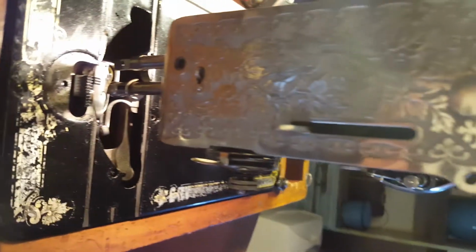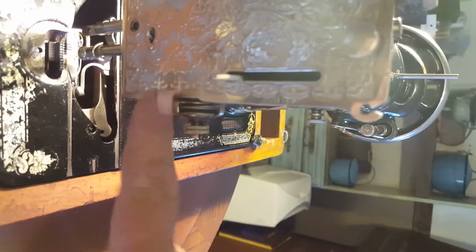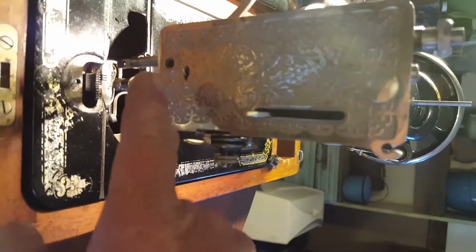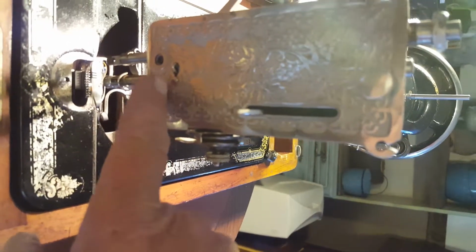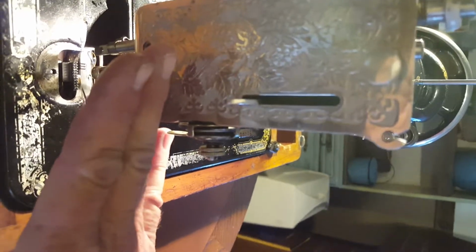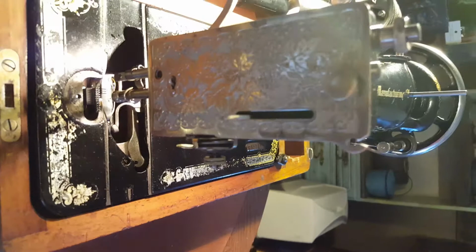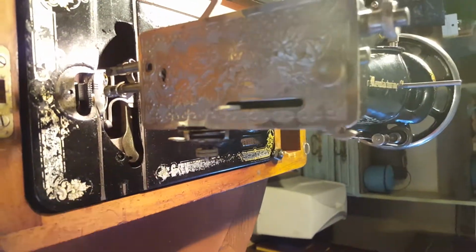And if there's been a lot of water inside, and this one, all around the edge of this faceplate on the inside, was nothing but built up rust. What it will do is it will pucker that paint inside, and it will make it just kind of form a little ridge up against those bars, and you're not going to get oil through it, and you're going to be fighting it. So just go ahead and take something, scrape that paint away, and then you'll be in business.